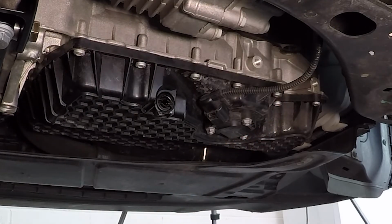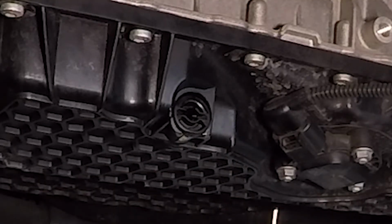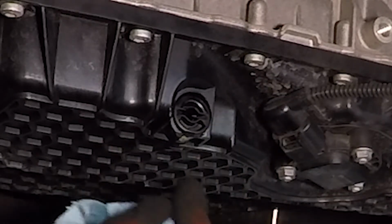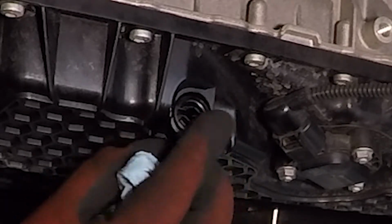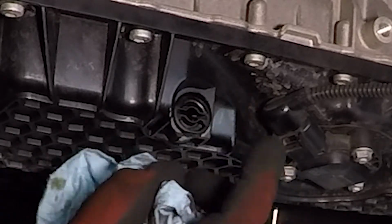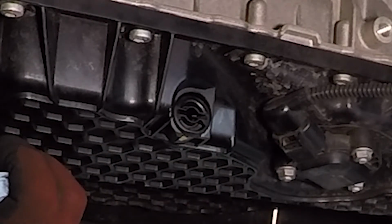So, this is probably hard to pick up here, but there is just this little section here, like a lip on the new screw, the replacement drain plug, and it just sits nicely in there. So you know there's no torquing or anything, you literally just turn the screw feature in until you hit that, and it's all sealed up down here and ready for oil up top.